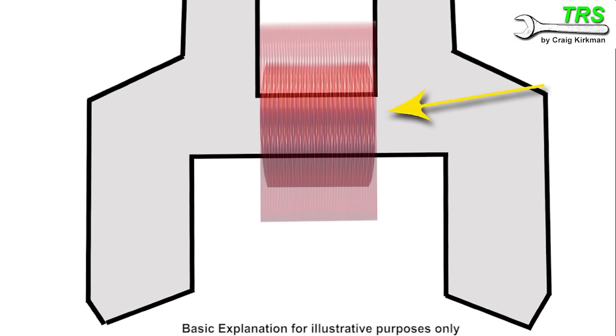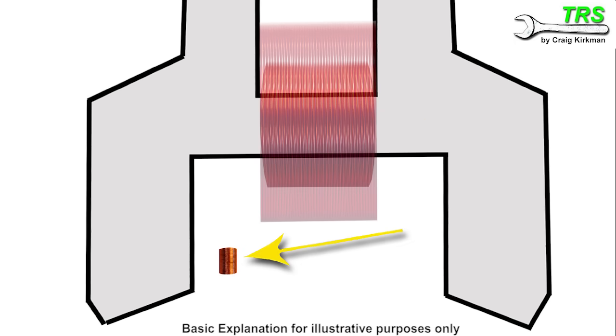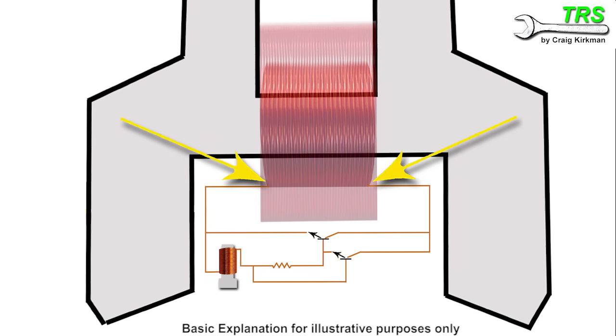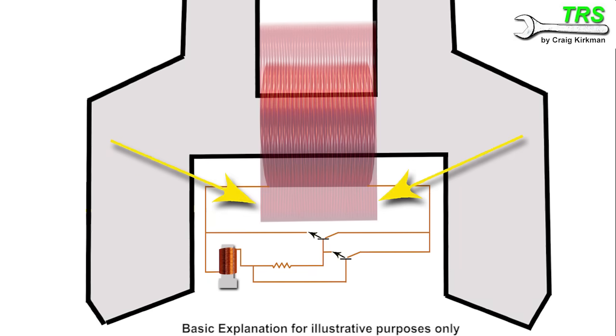But how does this happen? How does this create electricity for the spark plug? Well, it needs a kick start from something very similar but much smaller. This is known as the trigger coil or the initiator. This is also insulated copper coiled wire wrapped around an iron core. In fact you can see the iron core of this trigger coil protruding out the bottom of the coil pack here. It's this trigger coil that's wired to the small primary coil and has no contact with the larger secondary coil.